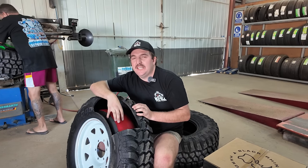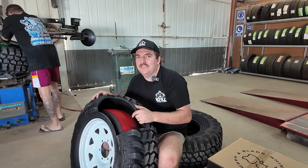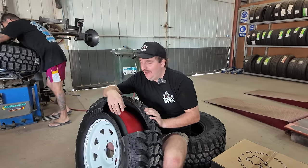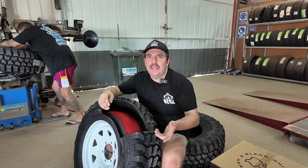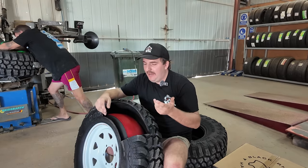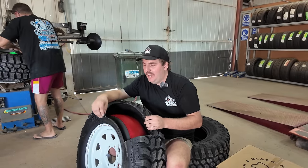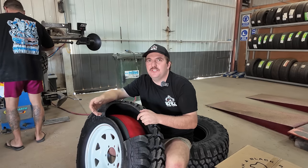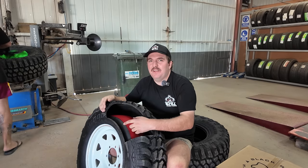Obviously you can see this tube is in here and this has locked the beads, but the rest of this area here, you can still inflate and deflate like as normal. But this actual inner tube acts as, you call it, a bump stop. On a traditional rim, if you've got your mechanical bead lock and you let it down to zero PSI, or you got a flat, or you slashed a tire, your tire would go all the way to the rim. And if you're on a steep hill in the middle of high country, somewhere where you can't stop, and you just have to bash it across a few rocks, you're going to damage your rim or run the risk of damaging your rim. So with these, it actually acts as a bit of a buffer.